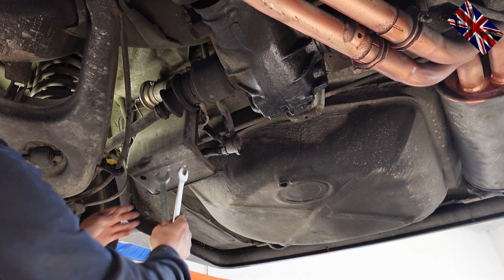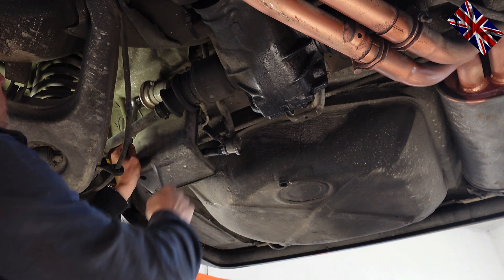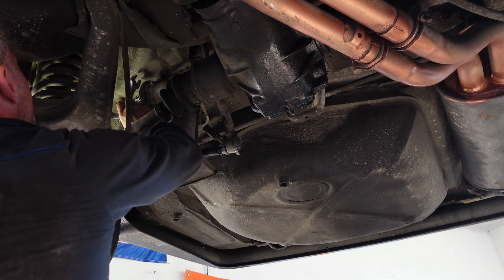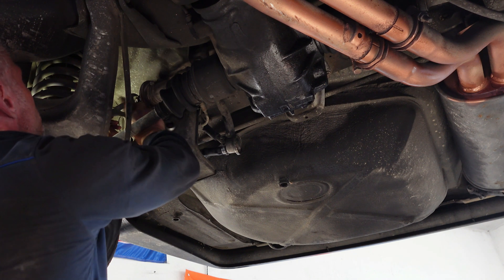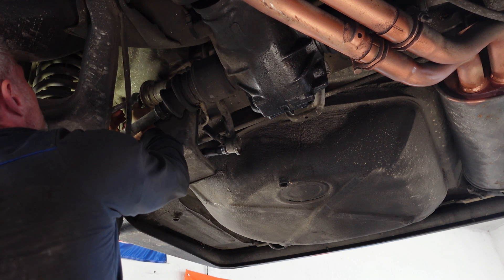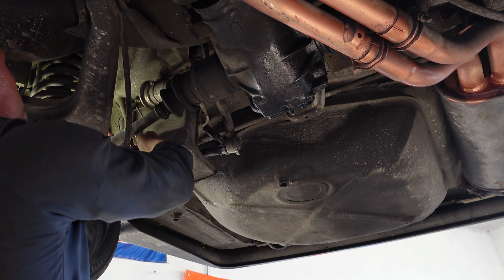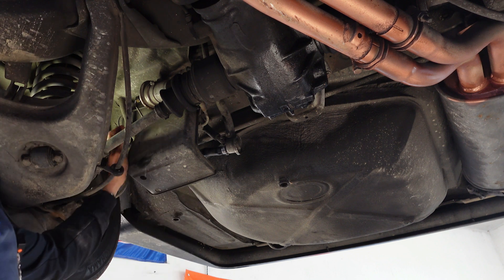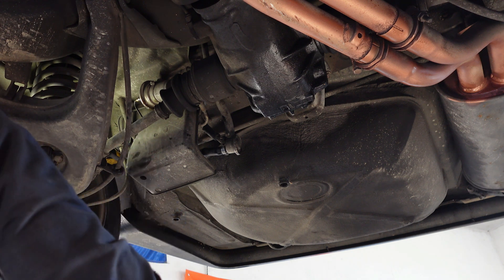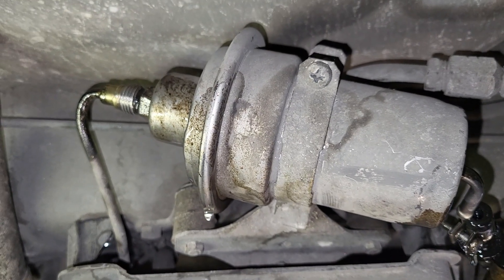Actually effortless to open. I do not expect a lot of spillage because the car has been sitting for a while and the pump is holding back the fuel. Some drops also from the remaining fuel inside the accumulator. Next, loosen the screw which is holding the clip where the fuel exits the accumulator. Last step: unbolt the mounting and take it out. Another important thing — if you loosen the connection where the fuel is exiting the accumulator, you can expect some minor spillage, not more.